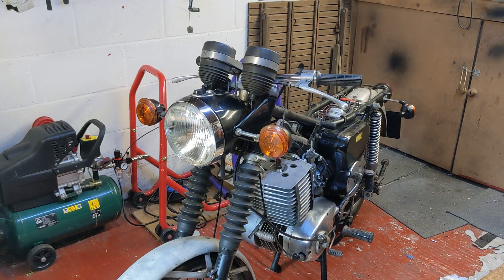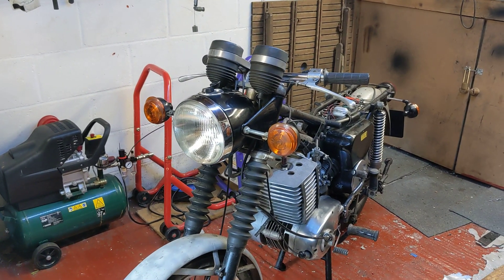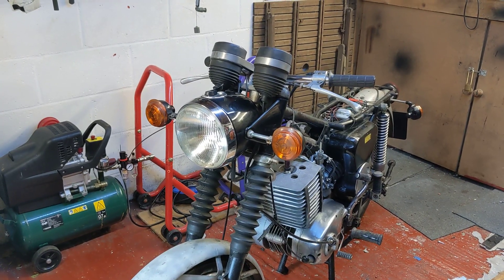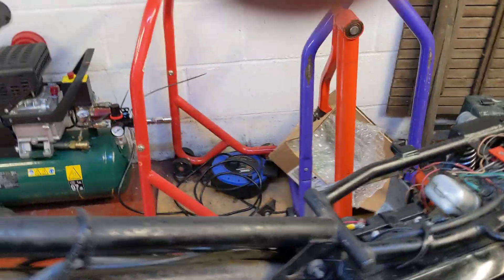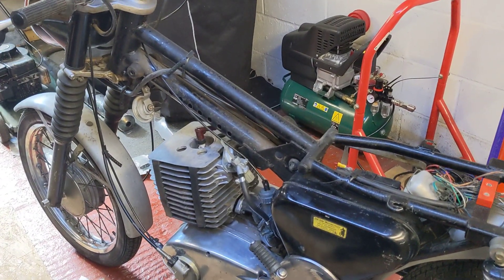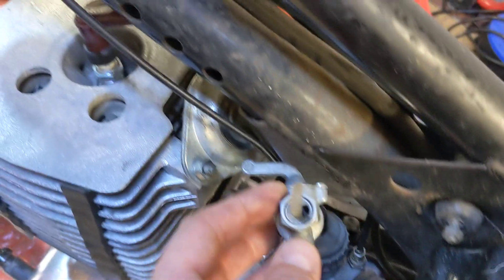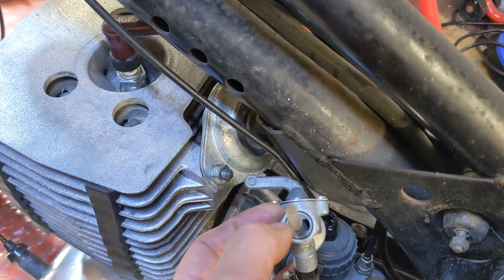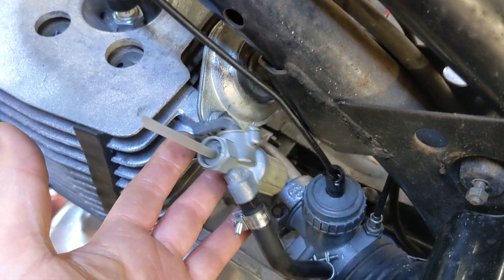It sort of runs, it ticks over now. I've adjusted the carburettor. I've got the plug a brownie colour. It would run nicely through all the gears. The only problem I had was it wouldn't do maximum revs in top gear. I believe it was a mixture of crappy fuel sediment. When I pulled this off, the actual reserve hole — this was completely caked in brown sediment. There wasn't much fuel in the tank, so I assume it was just volume of fuel; it couldn't get enough fuel in the carb.